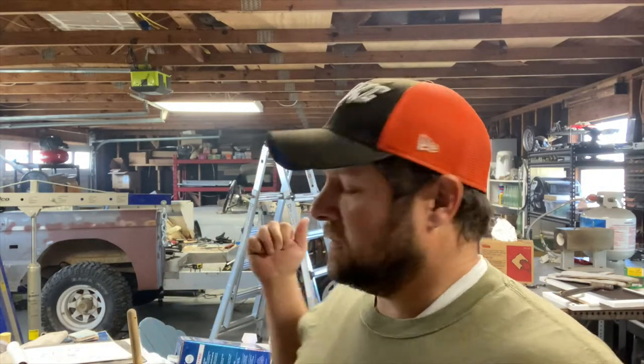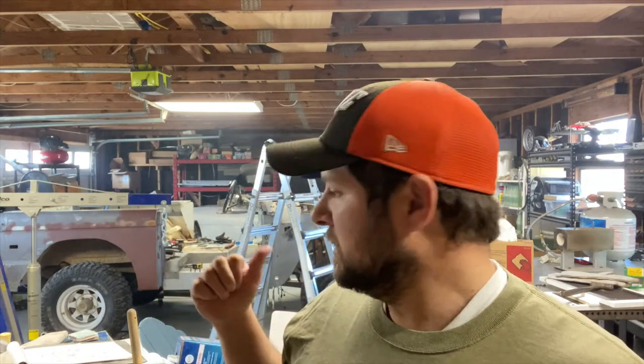Hi, and welcome back. You can see we got here pretty early today. So we're gonna jump on the middle of that, fill those two holes up, grind everything down, sand everything on that area clean. And then I think I have some 2-in-1 primer somewhere, and we'll spray that bare metal with it and call it good.